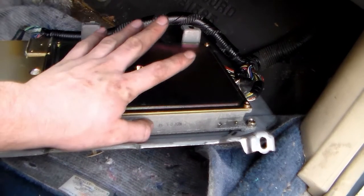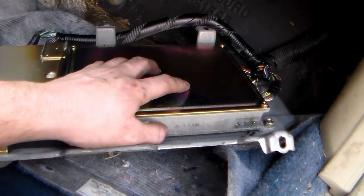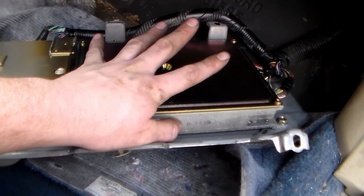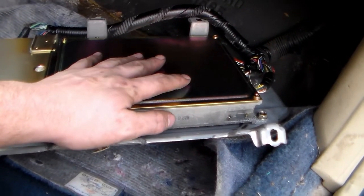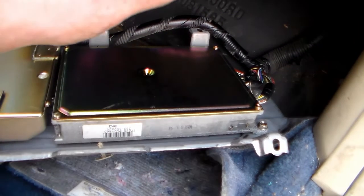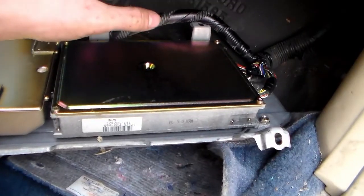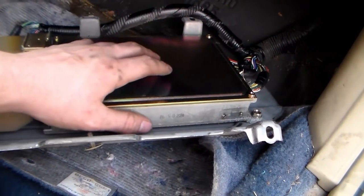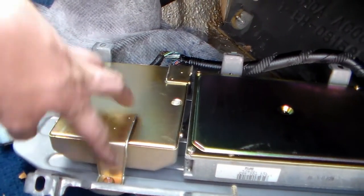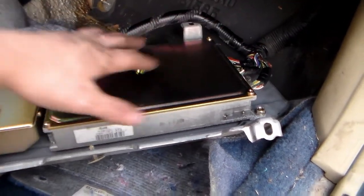This is important to note: this is an OBD1 1994 Honda Accord with an automatic transmission. 94 to 95 have different wiring than 96 to 97 and 98, because those are on OBD2 and they're a completely different system. I happened to get very lucky and ran across a 1994 automatic with VTEC to take a donor computer from, and with this being a 94, I'll be using the 94 pin out to convert it. These computers are held in with 10mm as well. In order to get the engine computer out, you have to remove the transmission computer — there's just a bolt here, bolt here, and bolt over here, all 10s, then one here, one there, and one here for the engine computer.